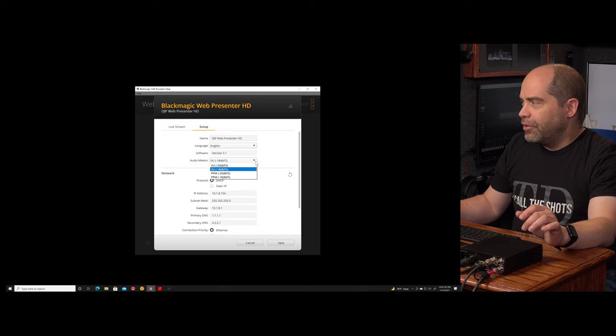The first thing at the bottom is a data rate graph and indicator. This tells us the current bit rate of data going out of the device, determined by which quality setting you've chosen. In this case with streaming high it averages a little over six megabits per second. If I was to go to a static graphic nothing is moving, so that bit rate would drop quite a bit — the device does dynamically allocate bits as needed. The quality setting you use is more like a maximum. Don't freak out if you see the data rate drop low when you're showing a static graphic. It's already encoded the video signal using those few bits and doesn't need any more.